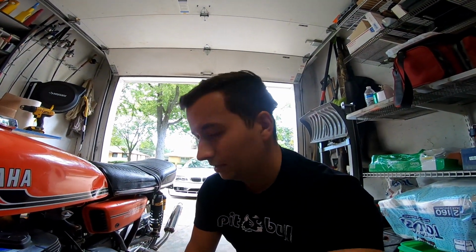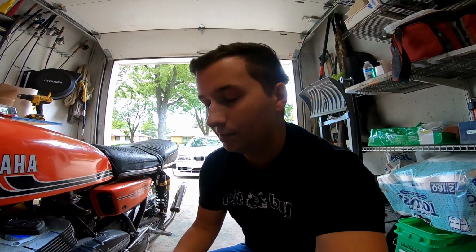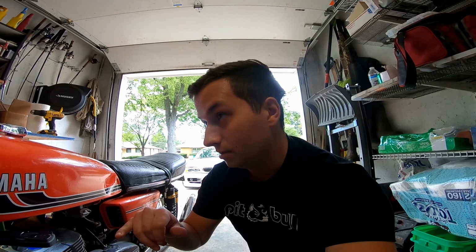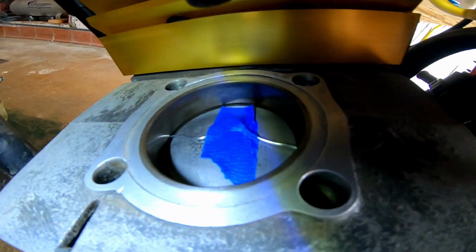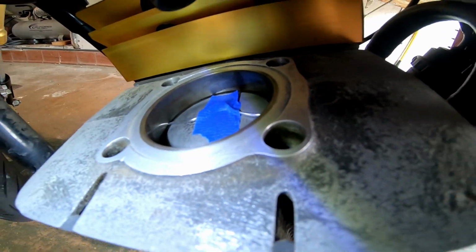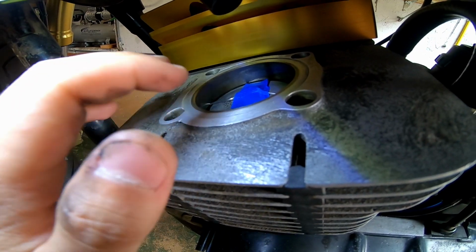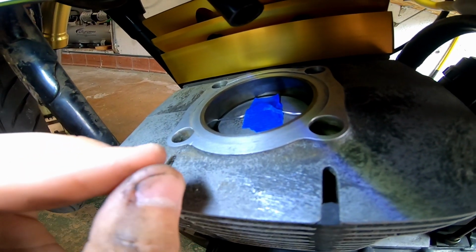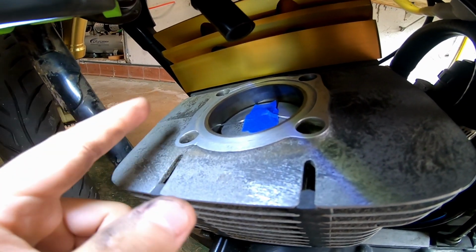All right, so I did some Googling. I think I'm okay, but I also reached out to an old friend that deals with a lot of two-stroke bikes. He does some flat track racing, and he used to race these bikes back in the day. Basically, what he said is the opposite of what I thought. He said to measure the squish front to back, and you're supposed to do both sides at once. So I took some solder, stretched it out so it's at the edge of each cylinder wall, and taped it onto the piston. It's on the upstroke, so as soon as I kick it, it'll go up. I'll put the head on without the O-ring, get the bolt snug so it's totally seated, and then measure and see where the squish ends up. Then I might have to repeat that on the opposite side too, just to be safe and consistent. So let's see what this ends up being.